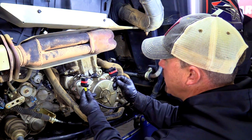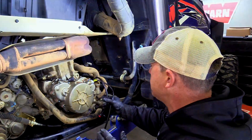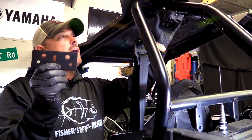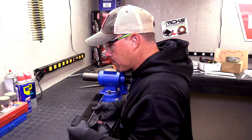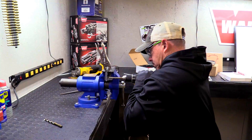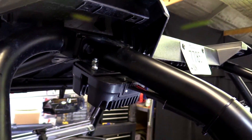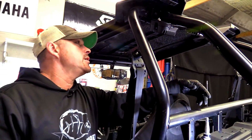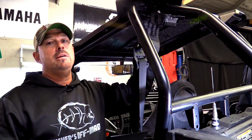Now you see you have two wires coming out of your stator instead of one, because you have two regulators. I've already mounted one regulator up on the driver's side, and I'll show you the bracket and how I'm going to mount it on the passenger side. What we did here is we made brackets for the cage so the regulator could bolt right onto the bracket and the cage, because the bolt holes weren't lining up for a direct mount. Whenever it comes to installing, I really enjoy making my own brackets and fabricating stuff so it looks factory — not like an afterthought. I think this is a really clean fit and finish. The regulator looks factory on there, and you're going to run your wires right down the cage using the zip ties Rick sent with the kit. It's going to get a lot of air and stay clean, and that's what you want.